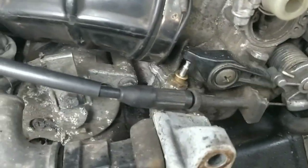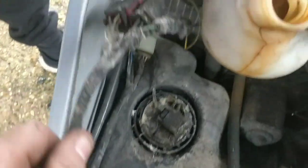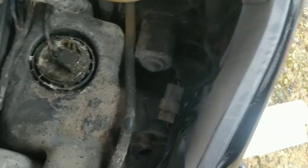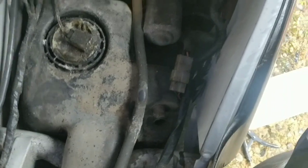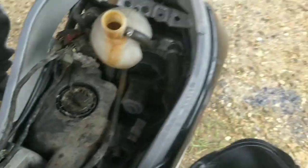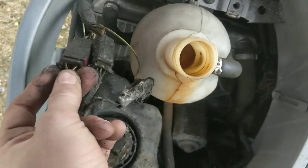These are quite complex bikes, these DNAs. I don't want to drop the petrol tank — it's a pain in the ass. At the moment I can't see the coil wires, which is what we might need to find. I'd be shocked if it was showing spark, and if it was it won't be showing enough. So let's start with the basics — let's get all of the wiring cleaned up because it's caked. That's terrible and it will look just as terrible on the inside, I'm sure.